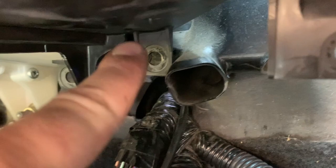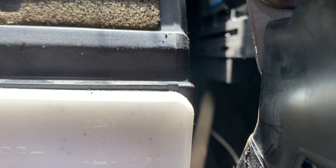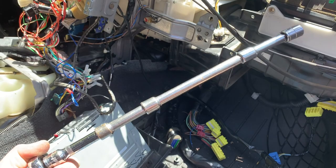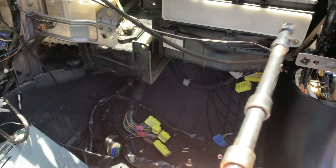There's another 10mm bolt right there holding it, or maybe just a plastic bolt — I'm not sure because I didn't have it. Then you have to undo that 12mm bolt, and there's another one right over there. To reach it, you have to have a big extension — you need it about this long to reach it comfortably and undo it from the outside. So if you're planning to remove it, first get the extensions.